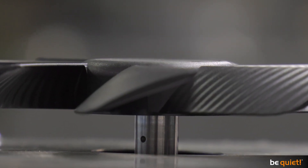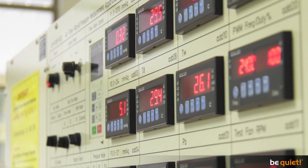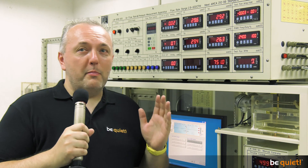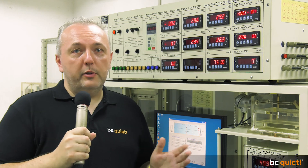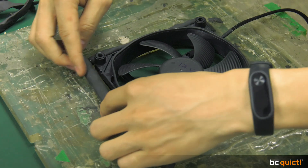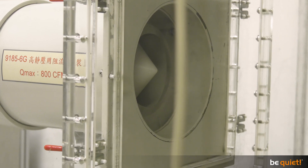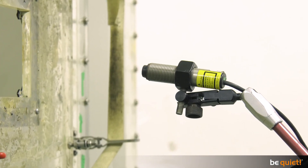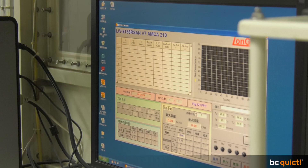In order to keep quality levels high at all times, we sporadically check our fans in the wind tunnel. This is where we put all of our fans to the test by measuring the air pressure as well as the airflow rate. It's a very complex and time-consuming process. For example, while developing our Silent Wings 3, we thoroughly tested more than 20 prototypes until we were satisfied with the results. The fans are mounted absolutely airtight in the front of the tunnel, which measures the amount and intensity of the air the fan is pumping in, at several revolution speeds measured exactly by a front-mounted laser, which of course have to correspond with our specifications.